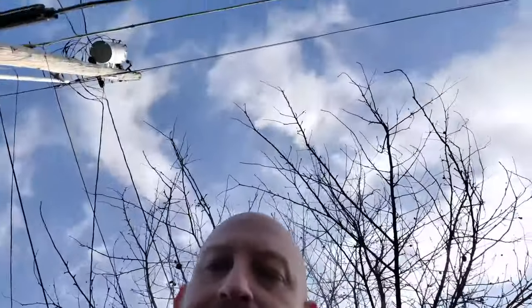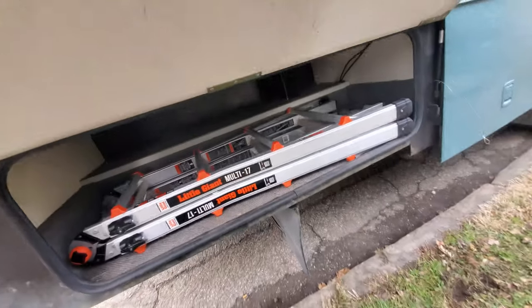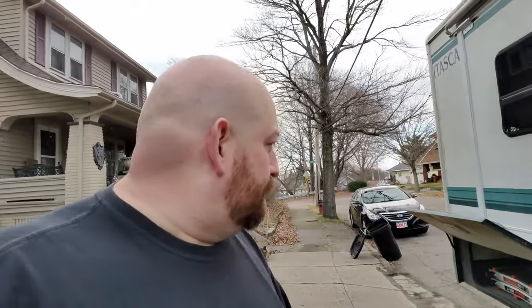Let's go inside. I want to get the mattress out of here and wash down the bedroom area before I close up for the day. First thing though, I want to put the slide out from the bedroom for a minute because I need to check — I've got my extra tire out and my Little Giant ladder in there. I need to see if anything is going to be obstructing the slide. If that tire obstructs it, when I try to put the slide out it'll push the tire into the door and damage it. Let's try that real quick.